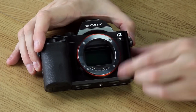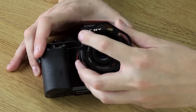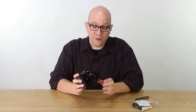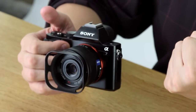And that's it. Now you have an all-metal mount for your E-mount camera. Let's put the lens back on — white dot to white dot, snap it into place. And now as you can see, the wiggling's gone. Now obviously you don't want wiggling ever, but since a lot of people use these cameras for video, they're going to want to use longer, heavier lenses, and that's when it becomes really important to not have any wiggle in the mount. So all we did was replace these two pieces — the plastic piece and the metal piece. You can give the old pieces to the cat. Now you've got an all-metal mount and this camera is ready to take on all comers.